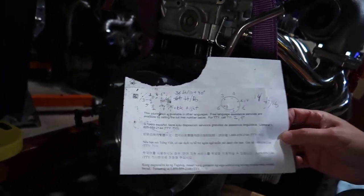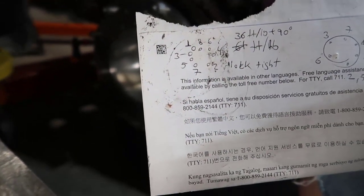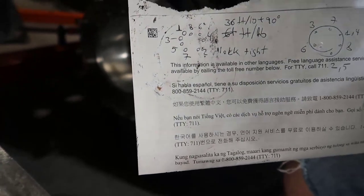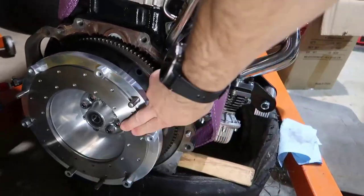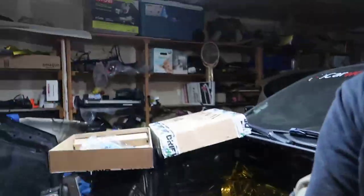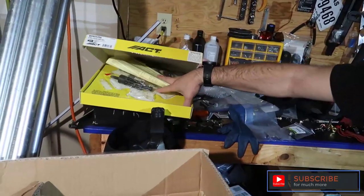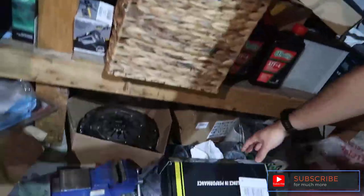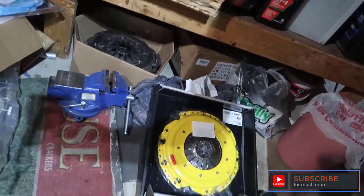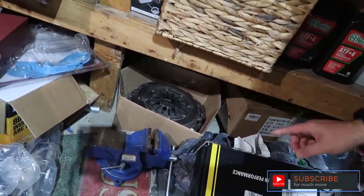If you're curious, here's how I wrote the torque sequence — you can see where I have the foot-pounds and the bolt order: one, eight, six, four, two, seven, five, three, and then back to one again. So that's how I knew which bolt to torque next. This part of the kit is now installed. Next video I'm going to install the clutch and pressure plate — the HCT clutch plate is right here and the pressure plate hasn't been opened yet. I'll also show the difference between the non-M3 and M3 pressure plates.